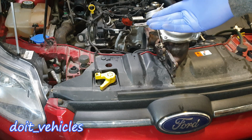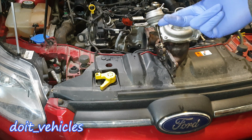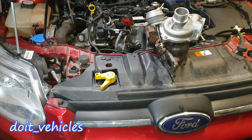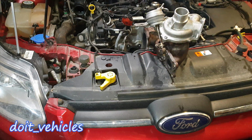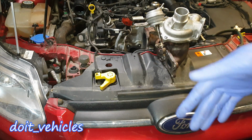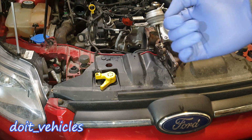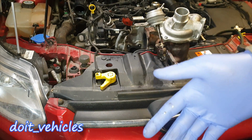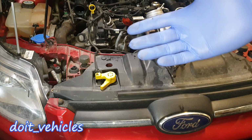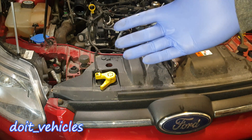For combustion, air and fuel are necessary. And fuel is very easy to add to the engine in order to produce more power. You just basically keep the injectors open for longer and the fuel will be sprayed there, no problem. It's easy to insert 1 liter of fuel at a time in each cylinder if you want to. So the challenge is to insert more air, because you cannot insert too much fuel with less air, because that's going to be a very rich combustion.